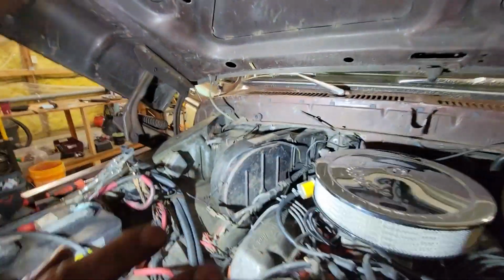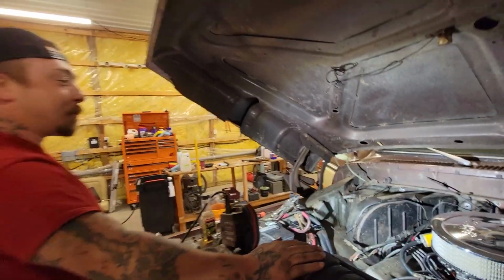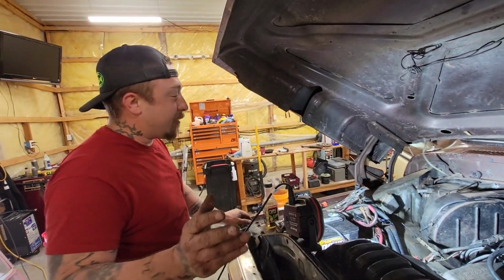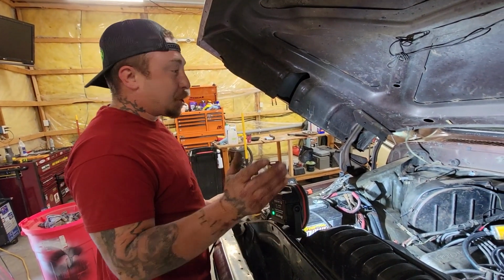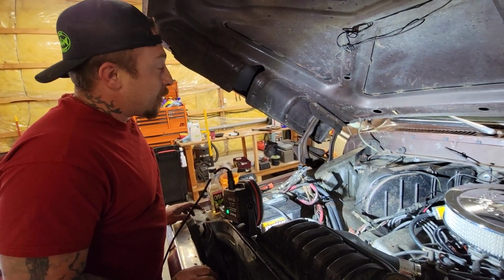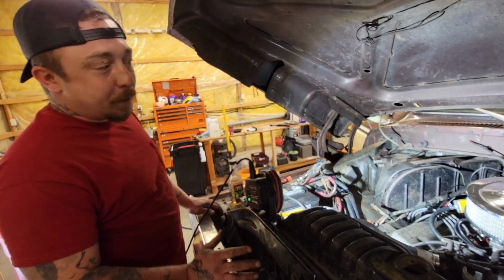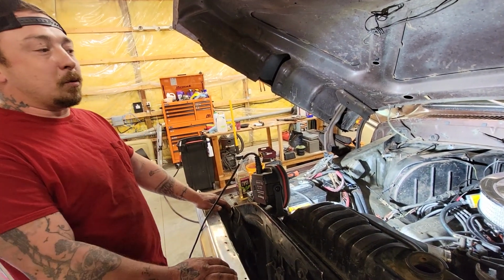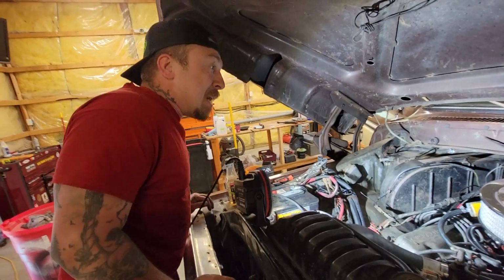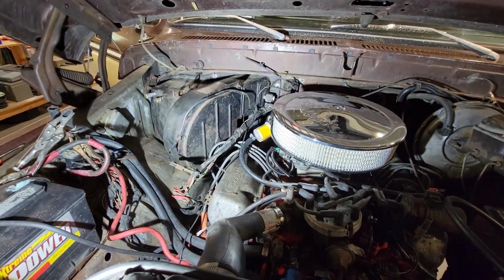And what we went back in quite a bit easier, and I'm sure you're going to see me taking a moment to pull this heater box out there. But on the inside, we've got everything heat wrapped, shrink wrapped for moisture condensation protection. It's time to go back in, hook some heater core hoses back up. I don't think we're going to put the original AC lines back in. We'll probably find a nice convenient way to cap them off, and back to dressing up the wire harness and make this look as pretty as it needs to be.